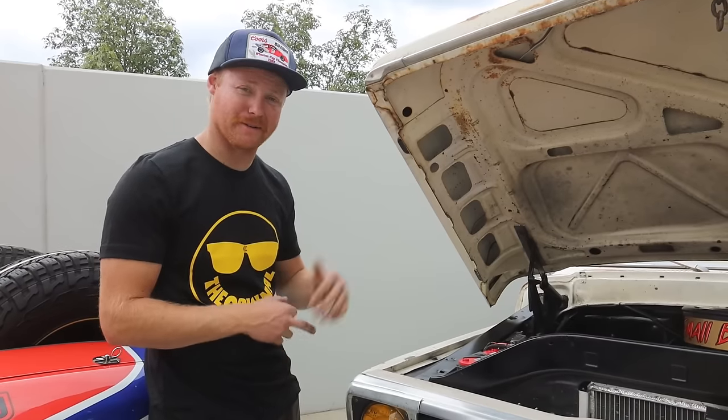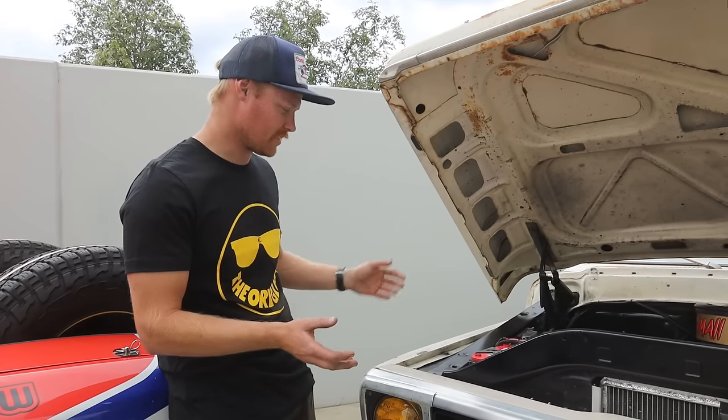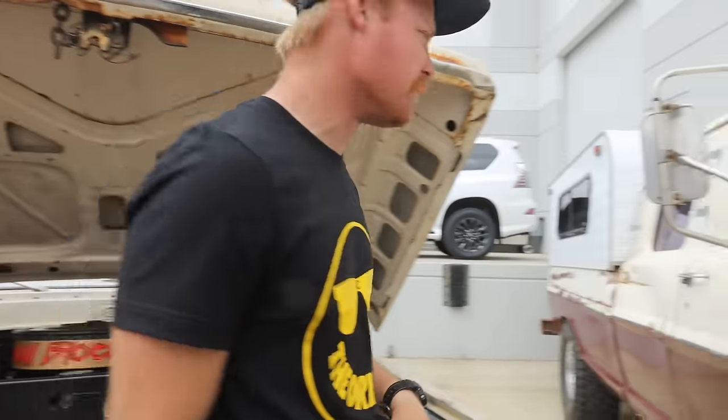That's the F100 on a quick rundown. The rear axle has been flipped — we made a video series on that where we flipped the axle for $100, put a C-notch kit in it, and cut a coil and a half out of the front suspension. That's how we got the stance. There's a full F100 playlist you guys can check out.